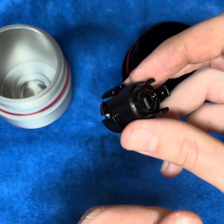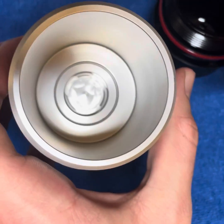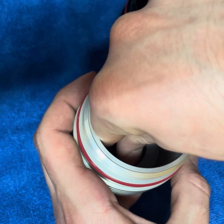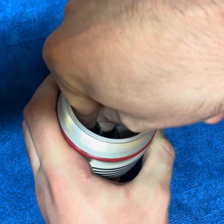To get the sub cage into the new oil filter housing, you're going to want to line up these plastic tabs right here with the metal tabs in the oil filter housing. That's how it should look, and then just grab it with your fingers and pop it right into place.